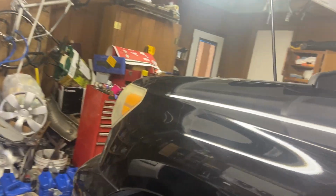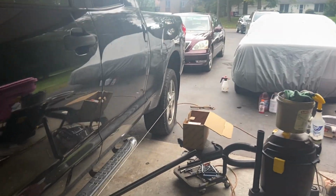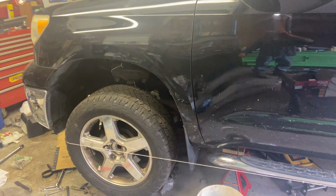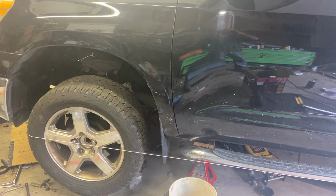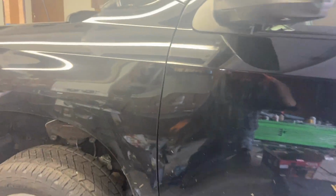So hopefully this is helpful. Like I said, the big help is this. If you haven't started yet, don't be a turkey like me and use a white paint marker. Scribe it, man. Get under there with like a sharpened, hardened chisel and pound it in if you have to. Just give yourself reference marks. I never imagined what I was getting into when I started this project, and the least of my worries is being a spline off in my steering, because I now know underneath this truck better than my bedroom and my office.